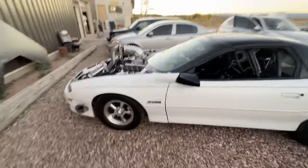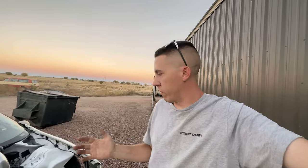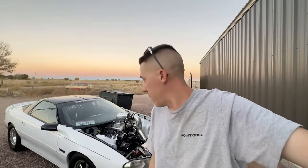And we made it — pulled in at 200 degrees, so actually doing really good. This little cardboard thing is doing pretty good, and ditching the diaper is helping too. It's about 75 degrees outside right now, so obviously if we're at 90 or 100 degree ambient we'd probably run 215–220, which some cars do run — I don't love that — but 202, hung at 207, then back to 202–200 toward the end, so not bad.